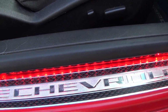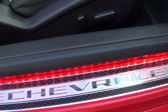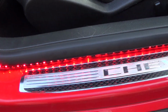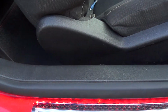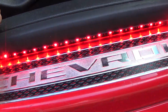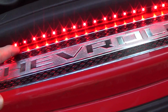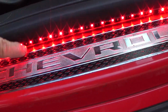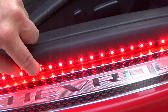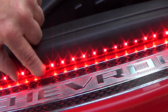If I put something like Liquid Nails, once it's there, it's there. I can't reverse it. When the strips go out, it'd be really hard to get it off. With the silicone, I could pretty much peel it off if I had to. And it worked out really well. The double-sided tape on top and not on bottom meant no thickness on the bottom, only on top, and it caused it to point outward. So that's why it worked out well with the double-sided tape on the top half, but not the bottom.